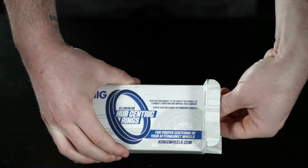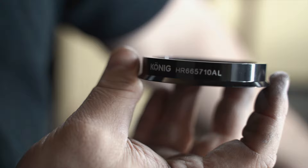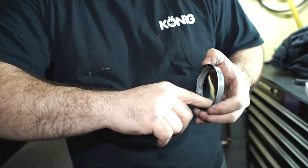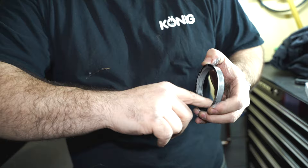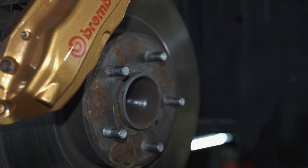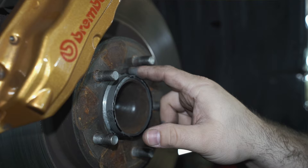We'll open up our box of hub rings — you can see these are nicely powder-coated with our engraving. They're high quality aluminum hub rings and really light. We're going to take the anti-seize and lightly coat both the inside and the outside. This is also one of the major reasons we recommend plastic hub rings — if you don't need them for heat dissipation, the plastic hub ring isn't prone to corrosion at all, meaning you don't need any anti-seize or special treatment. The plastic ring itself is a barrier between the two metals. And again, we want to verify the ring is very snug — both on the hub and in the back of the wheel.